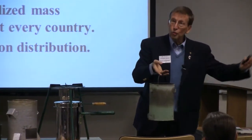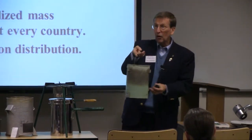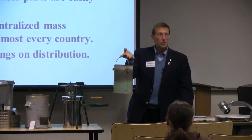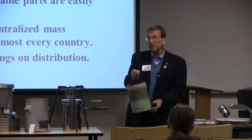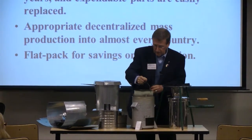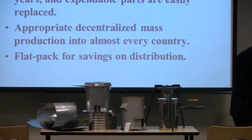You get to the bottom and let the primary air come in with full force, and you can make that whole metal on the bottom glow red hot, which will shorten the life of the stove. I've been saying for years: take the char out, dump it out and lift it out. Now we have the T-char unit over here as to how that can be handled.